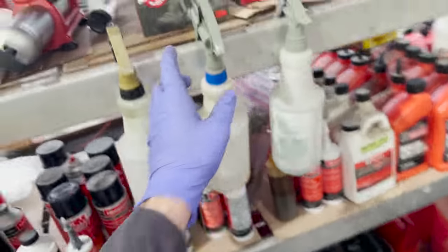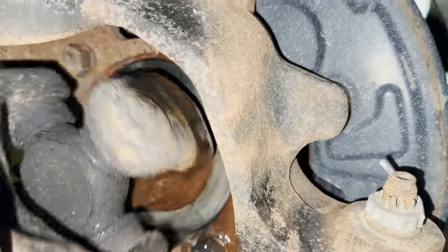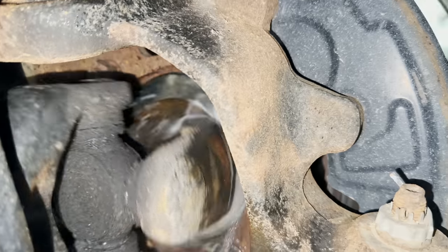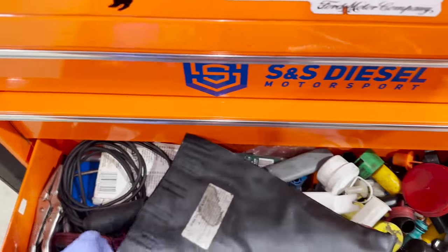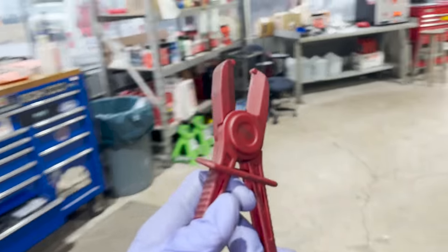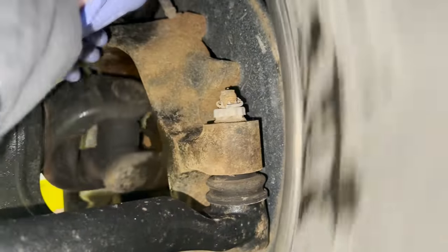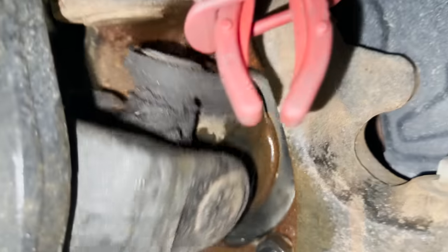Now I'm wondering — is this not only a squeak noise but also a vacuum issue? Let's try something. Let's go over to the toolbox. I don't have any way for it to get out of 4x4 other than it losing vacuum, and I don't want to pull the hose off, so why don't I just crimp the vacuum line. Let's see what that changes — no difference.